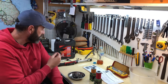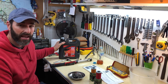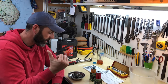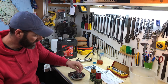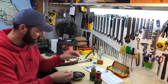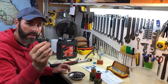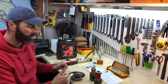I've got the 10W60 oil here — it's a German Liqui-Moly that I've been recommended, got it for a fair price. It's for off-road bikes, so we'll see how that runs for this trip. A couple of oil filters here that I'll preload with oil before putting them in the bike. The torque settings are: main oil drain plug 20Nm, oil screens 15Nm, and the 6mm bolts for the oil filters are 6Nm. Let's preload and get everything ready.